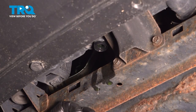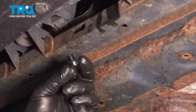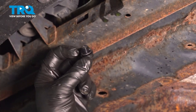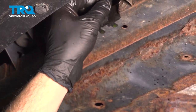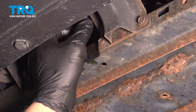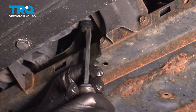Now with the radiator pretty much drained out, you want to go ahead and take your drain plug and inspect the O-ring on here. Make sure that is in good condition. If that is flattened out, torn, or shredded in any way, you have to replace that now. Ours is in good condition. Let's go ahead and reinstall this here.